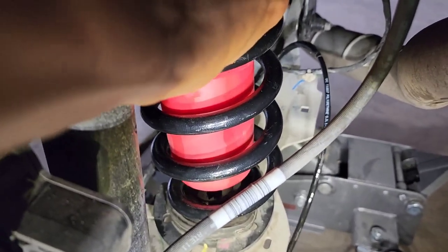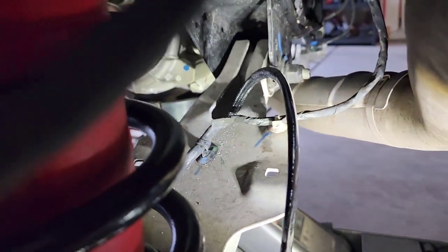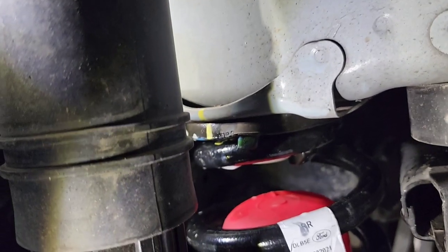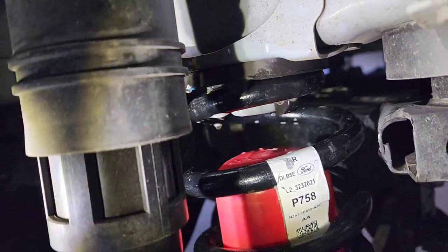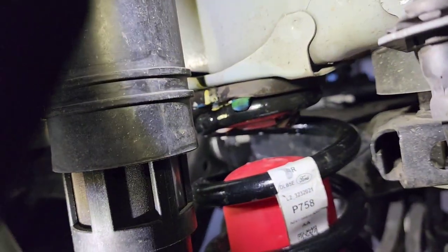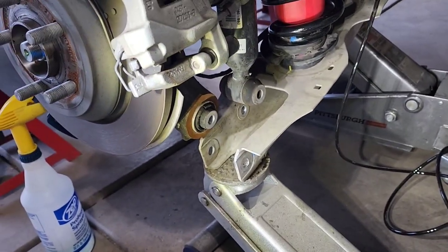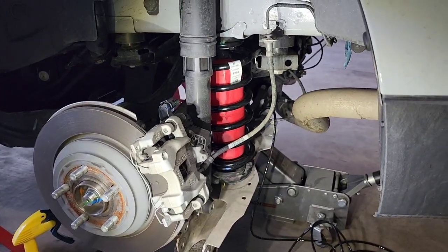The hose is attached to the bottom. The hose isn't kinked. And then the portion that's coming out is protected by the wire loom. And I also put alignment marks on the top for that little rubber gasket. That's all lined up. I lubed it up so the spring could just slide over a couple of those little rubber teeth. But it's basically just jacking it up, put those two bolts back on, and put the wheel back on. And that should be it for one side.